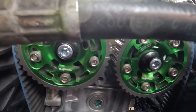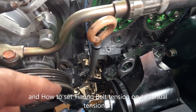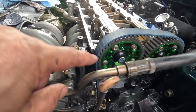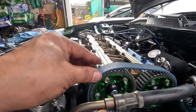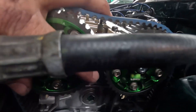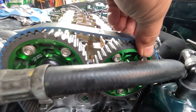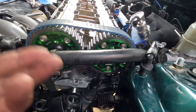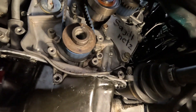This is how to install a timing belt. I always start from the bottom, then stretch the belt. Since this is aligned to the flat side of the cylinder head, put on the belt like so, and here I line up the two-dash line, just about getting ready to stretch the belt. I'm gonna go underneath.